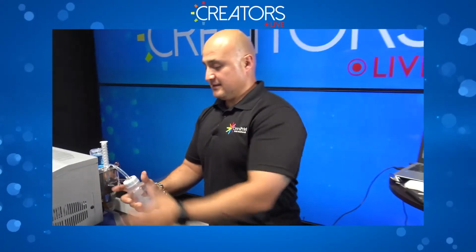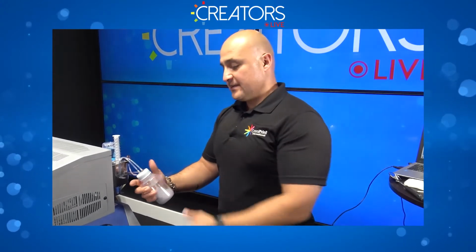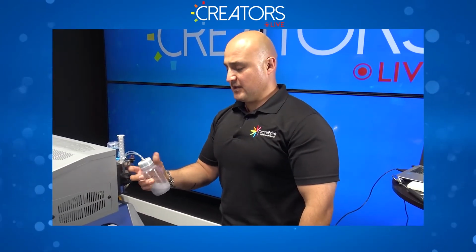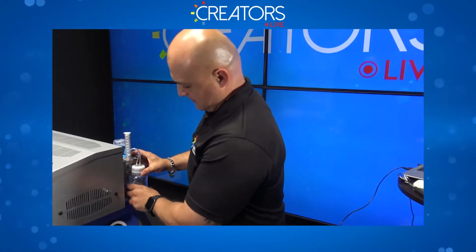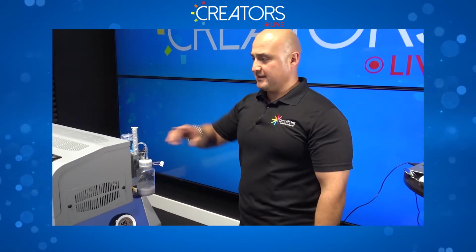So if you grab this bottle like this and you are unable to untie it just using these two fingers, it means it's super tight. So just loosen it, grab it, tighten it. You should be able to do this. If you are able to do this, then this bottle is properly tightened, and it will never collapse. That's pretty much it. All right, now the last part that we want to go ahead and maintain is the encoder wheel,